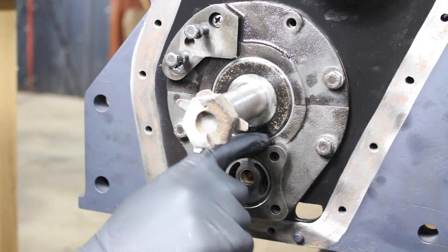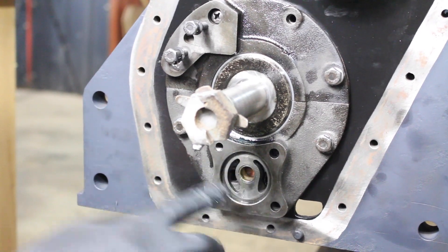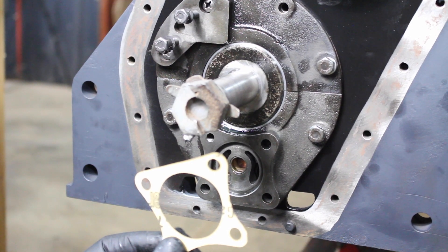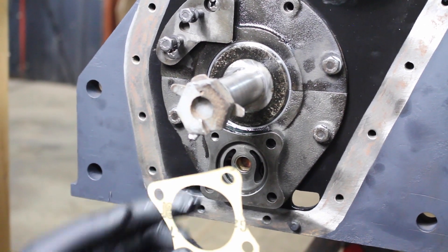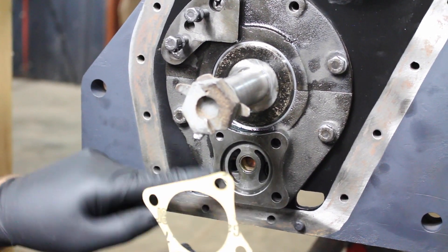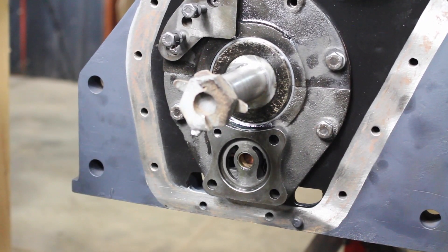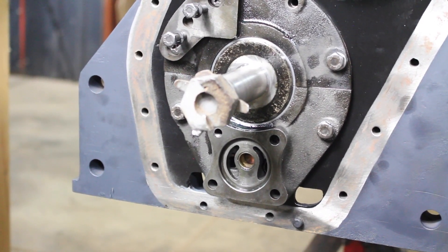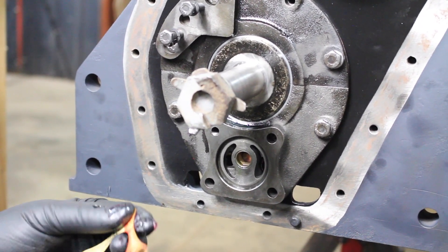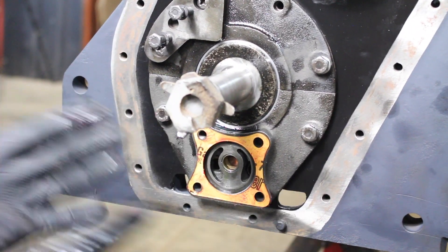Same thing again — there's a little bit of assembly lube here, a little bit in there just to help it. We have a gasket to fit on here. It's not really a sealing gasket — we're not trying to keep anything in, but this is just to take up any problems we may have with the two surfaces going together. When I fitted the gasket I used a little bit of grease and that's what we'll use again — absolutely perfect for what we want to do here. We can only go one way — there we go, there's our gasket.